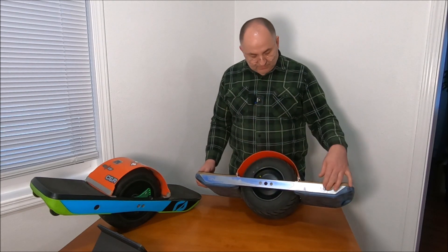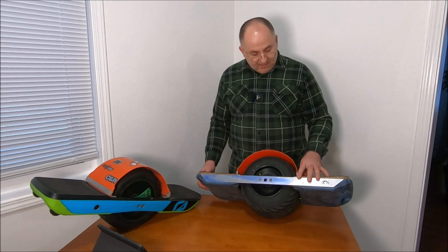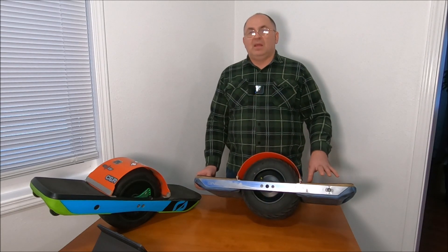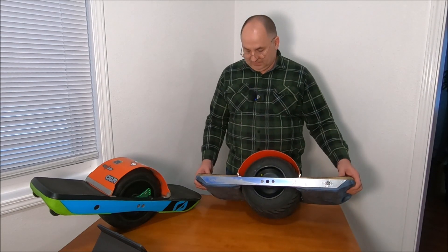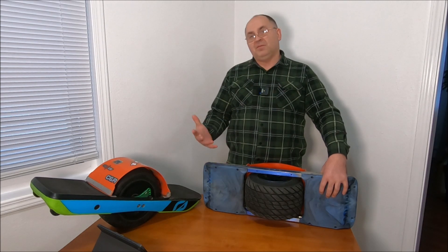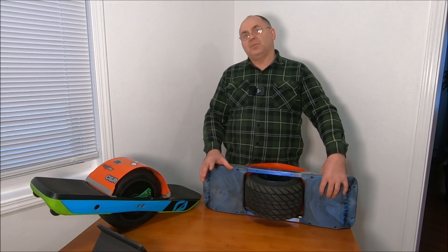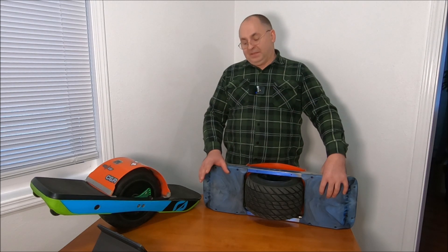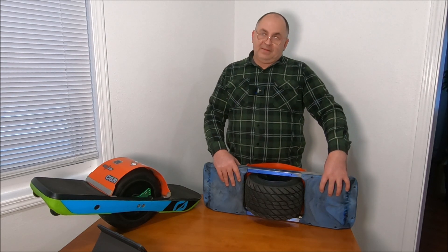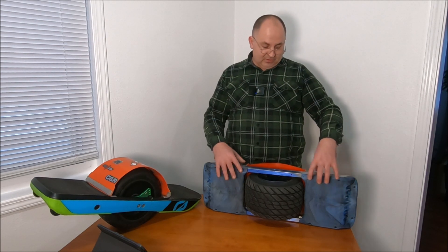I modified and redesigned the rails a little bit. Outside it looks almost identical to before, but now this wheel has an 18S3P configuration. I used two rear badger boxes from Fro-Life — they fit and can hold a maximum of 18 cells, so 18S2P in the back. On the front I got 18S1P. Those two packs together make 18S3P.